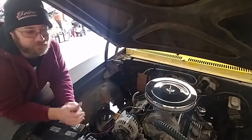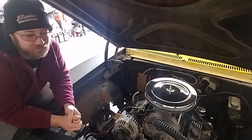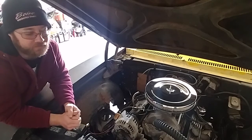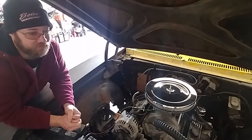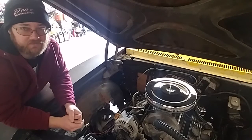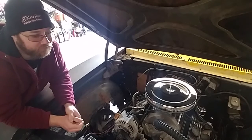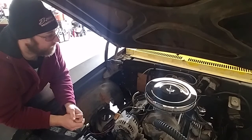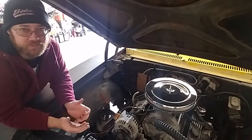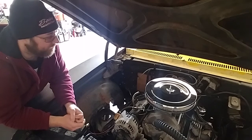I know the front pump is still kind of wet, but if it's the front seal up there where the torque converter goes, I can't see up there at all. I did change that seal when I put the transmission in, so it's brand new, but it's hard to say if it got a little tear in it or something happened when we were putting the converter in. And this car sat for several months before it got started, so hard to say if it just ended up drying out or something.